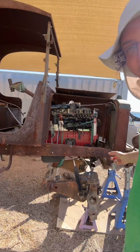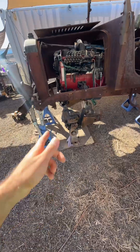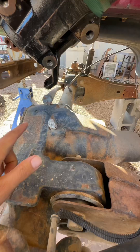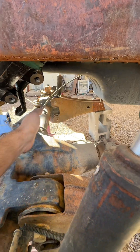I've got a couple options. I can take this front axle and move it back, but I think that would ruin the look of the truck, because the original front axle sat right here where this one's sitting. Plus, it's always nice to have your front axle forward — it makes your approach angle better. And it's really nice where the axle currently sits, because everything clearances the oil pan just fine.